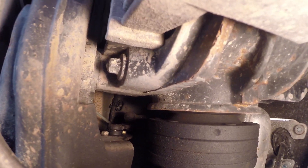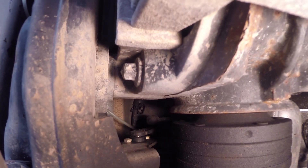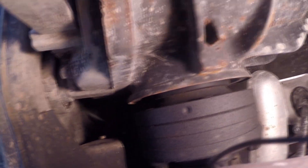The rear link is located on the passenger side of the vehicle, up above the diff. You can see it up there — there's one side. This is the exhaust, and there's the sensor on the arm. It's actually in a bit of a difficult place — somehow I've got to get up there, pop those off, and get the new one in.